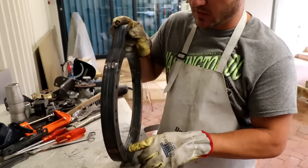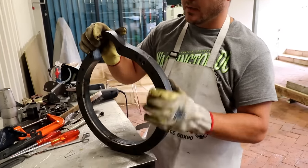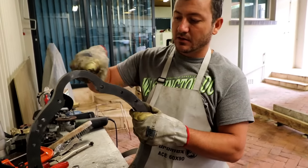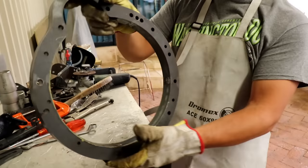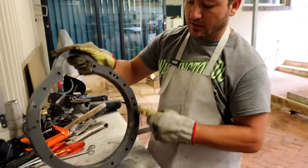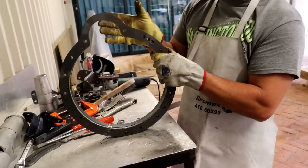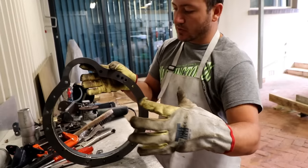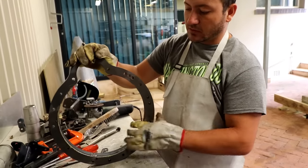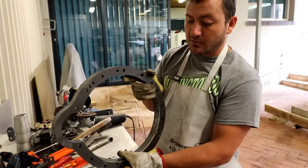Yesterday we showed you the match-up plate fitting on. Now we're going to transfer everything we modified on the first one to the rest of them. This works out cheaper instead of CNC cutting out of a billet — we cut three or four plates, weld them all together into a solid piece. That's our adapter plate, which allows us to go from the engine diameter to the bell housing diameter with all the different PCD holes for lineup. Now we're going to drill and tap these and countersink them so this mounts directly onto the motor, and then we bolt the bell housing of the gearbox onto this adapter plate.